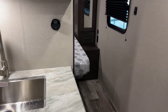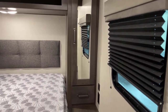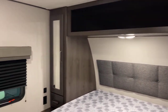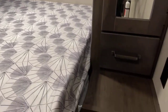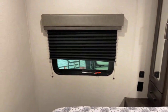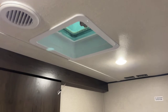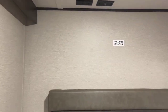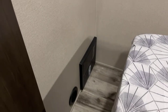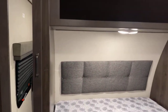There's your unified control thermostat. Into the bedroom — look at these valances and pull-down shades. Shirt closets, his and hers, one to each side. USB charge ports and 110-volt access on both sides. There's a full-function egress window for ventilation. Rooftop vent overhead. The TV backer area is prepped for easy addition of a bedroom TV with coax and 110-volt power already set. Furnace duct down below and fuse access in a convenient, easy-to-reach location.